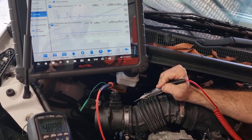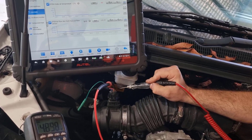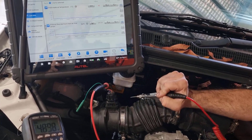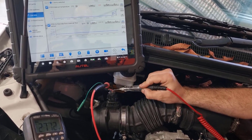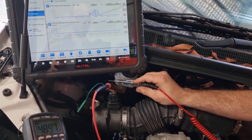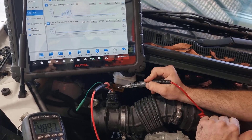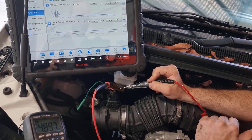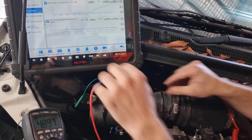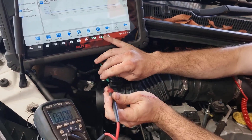This mass airflow sensor's job is to utilise the power and ground, and it's going to create a frequency — more so it's going to be pulling down to ground to create this frequency back to the ECM, and when it sees a specific frequency, that's where it knows the temp. So I've just proved my wiring integrity and my PCM and all those kinds of things. But really, the main thing I want to prove is that we have a stable earth supply to this MAF, because it's not going to be able to pull down to earth if it doesn't have an earth to pull down to.